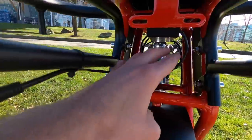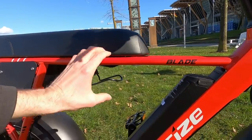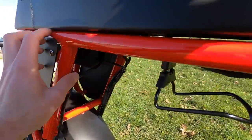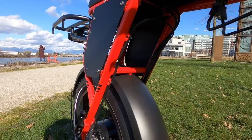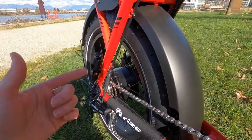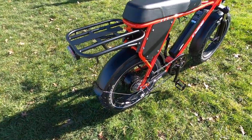Maybe you could hide something in this little cubby area under the seat. There's a really long banana saddle right here, with bottle cage bosses below that for a horizontal bottle. You might get a little bit of leaking right onto the battery, but these are fairly water resistant, as is the display and the controller, which is right there in that open area — pretty well hidden, with quick disconnects. It's a pretty powerful controller connecting to the motor — fat bike specific, 750 watts for the US, 500 watts for Canada. We are in Canada right now, so we're complying with the legal limit of 32 kilometers per hour top speed, and it has a throttle that you can disconnect.